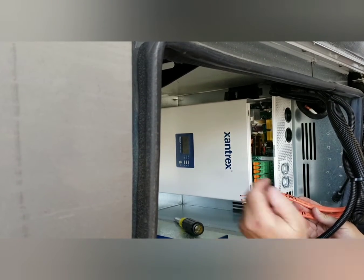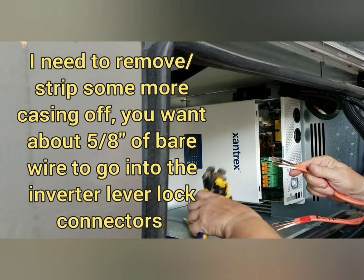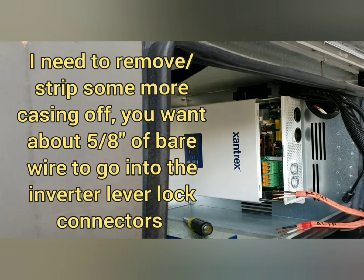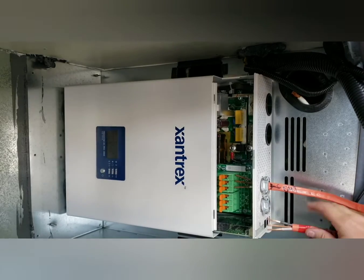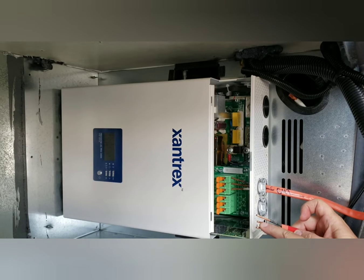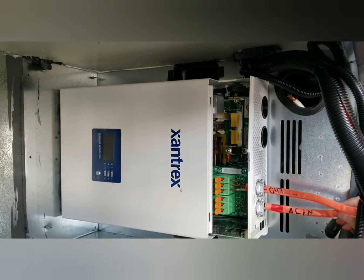White wire, black wire. One thing I noticed — these wires are heavily cased. I'm going to remove some of the casing and come back. There's a specific arrangement labeled inside: NGL — so N is neutral, that's the white wire; G is ground, the bare wire; and L is the line, so that's the black wire. You need to make sure you put them in the holes in that order.